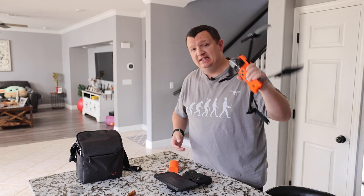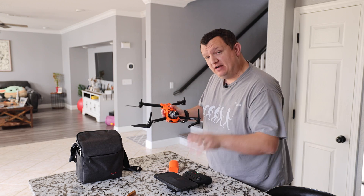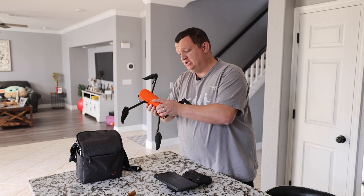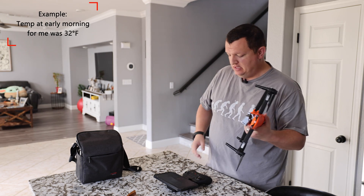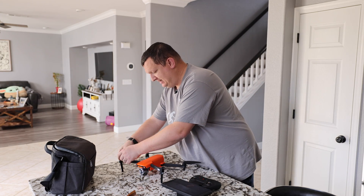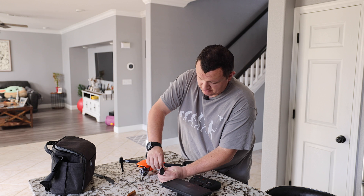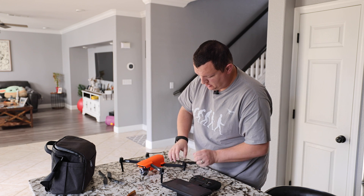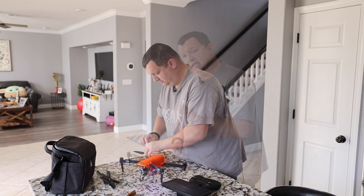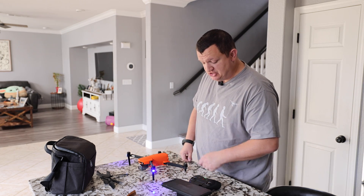The way I do it first is I leave the drone out — not in the freezer — but out in the cold outside on a very cold day, whatever you've got to work with, so it's cold to the touch. The goal is not to damage it, not to leave it out in the rain, but just leave it out in the cold. When I do IMUs, I like taking off the propellers, but it's most important to do this all in one take quickly and capitalize on your chilled drone.